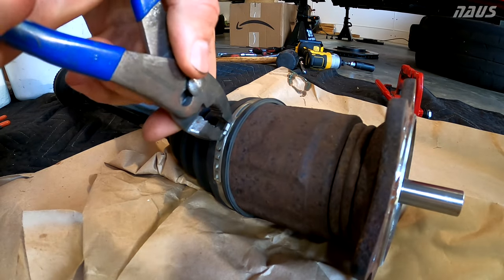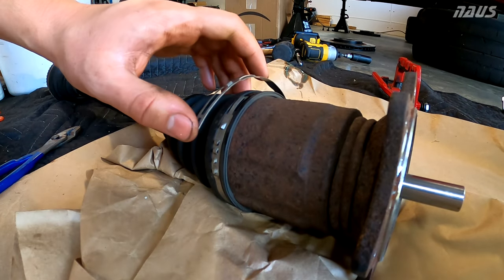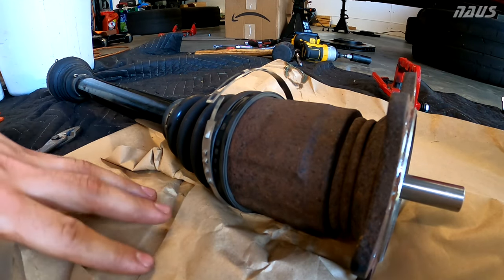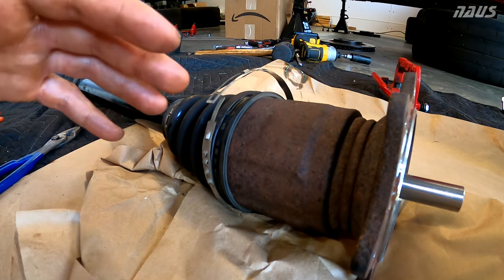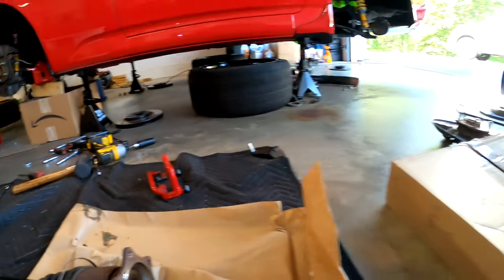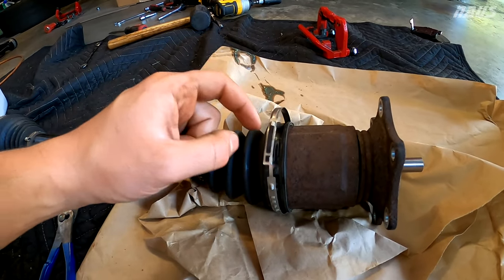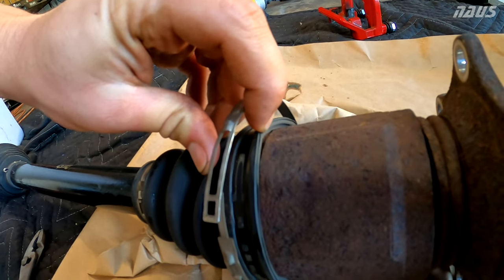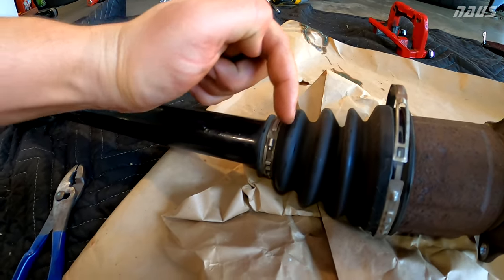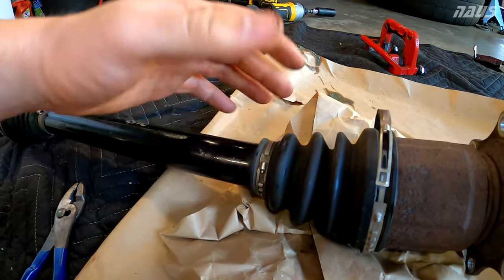Here's a look at how easy it is to get this boot off — pop it out, let go, and that's it. Now you can take this off, and it's the same process for the inner one. Make sure you have some paper, a bucket, or a giant rag. When you pull this boot off, grease is going to spill out. The right way to do it is to take all of this off and get the boot completely off, because my car has a lot of rust. When I pop this boot off, rust stuck inside the lip is going to fall and contaminate the grease. If you don't take off the whole boot, there's going to be a pocket near the clamp with old grease you can't thoroughly clean.